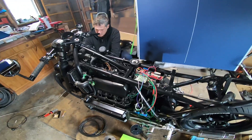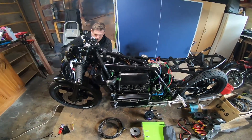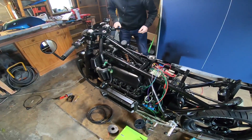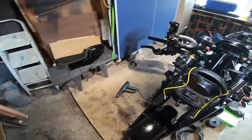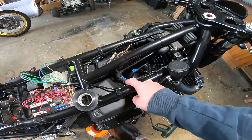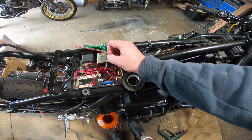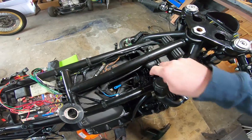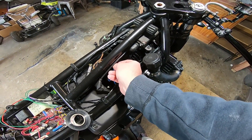Hello and welcome back — we are back in Greg's shed again, final home stretch for me. Greg's got a few little pieces to go yet but we're going to get this thing running today. I've just soldered a couple of cables — we've got the oil pressure switch which is this green one, this red one goes to the cooling fan, and the other side of the cooling fan is this blue cable which we're going to connect to the ground of the frame.